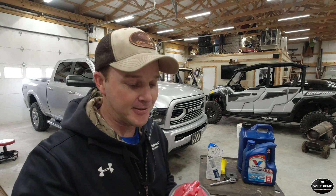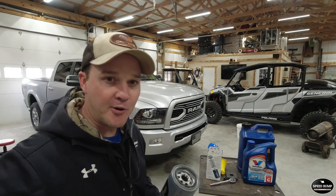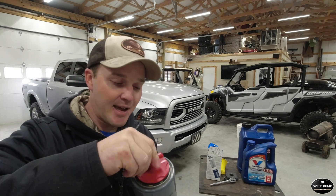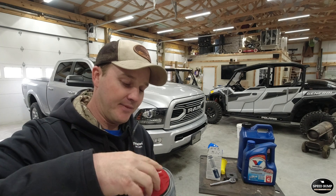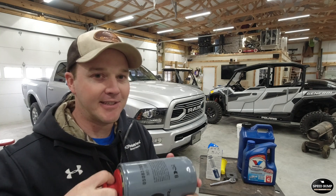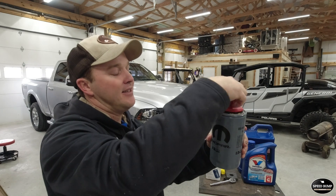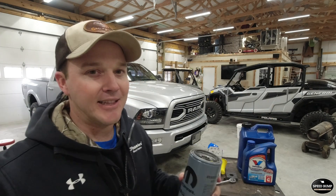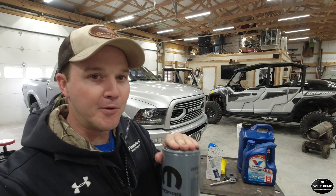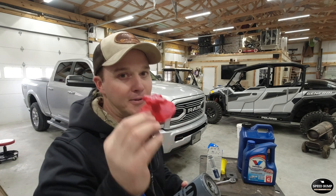This tool is useful on lots of vehicles if you can find the right thread size, but especially on this one. Going back together, you can actually fill your oil filter all the way up with oil, cap it again — so you'll have a full oil filter the way you're supposed to — which you couldn't do without this cap. Stick it in there, take your cap off, and install it. That's going to prevent that dry startup. You'll be starting on a full oil filter — that's the way it needs to be done.